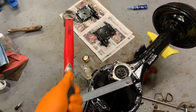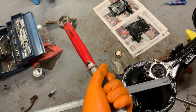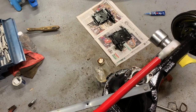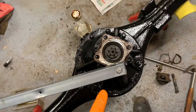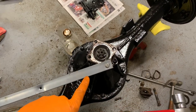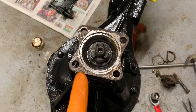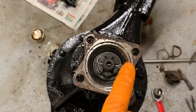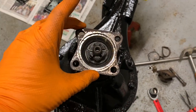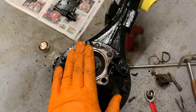I'll show you probably my favorite tool, which I don't get to use that often — the big red torque wrench from Tang Tools. I got this about 10 years ago and it was an absolute bargain, about £20 brand new. The nut here has to be done at 85 pounds feet — that's a correction from earlier, I've just looked it up in the owner's manual. With my bar on to counter-brace, let's get this tightened up. And there we have it — the differential flange nut all done up, and the all-important split pin fitted, because you really don't want that nut coming off — the flange would pull out and your prop shaft would be flailing around underneath the vehicle.